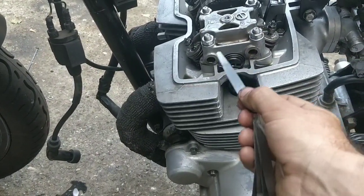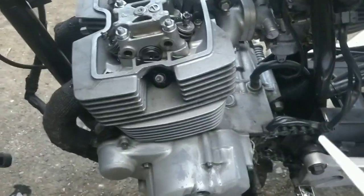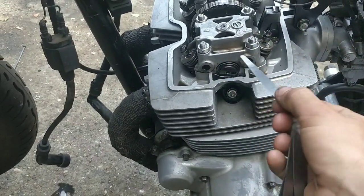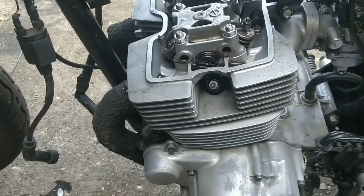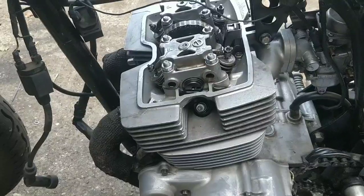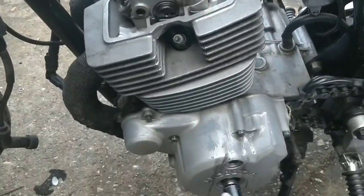It's currently still doing its job — it's letting the engine rotate — but somehow it snapped. I took this off to get to those bolts and it kind of fell out, so I'm going to order a new bushing, which I've already found. Just need to order it and get it on with Loctite. In the meantime, I'm going to set the valves.